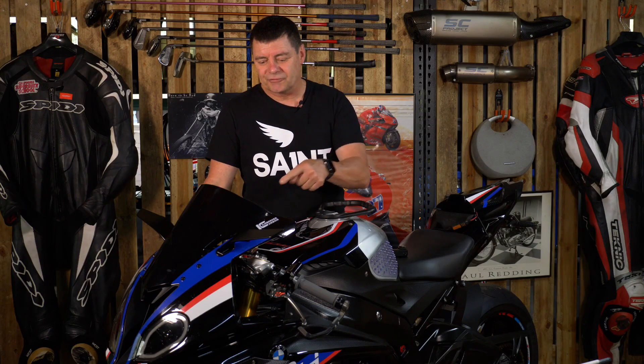If you've got one of these BMW S1000RRs, they have an interesting setup with the dynamic damping control. The front compression and rebound damping are adjusted in a single movement, so you can't separate the two. At the rear end it is separate. What I'm going to talk about in this video is how you can separate the front and get more adjustment at the front end suspension.